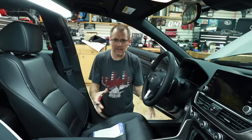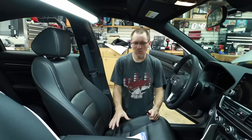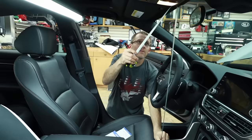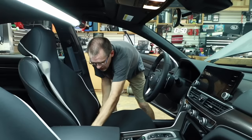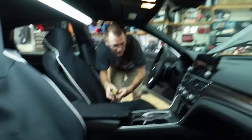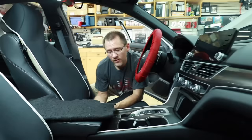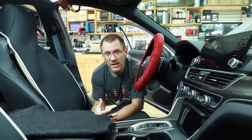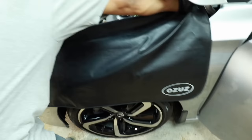We also gauge how big the customer is when sitting in the car, because we still need to tune the car. He's a tall gentleman, so we'll have to shim ourselves up in the seat so we're at about his head height when listening. Anytime we bring a car into the install bay we want to protect as much of the interior as possible — carpet over the armrest, a gear shifter boot, and the steering wheel gets covered. Any panel that's going to be removed or could possibly get scraped gets covered in tape, a couple different layers. Because we'll be working on the battery under the hood, we also protect the side of the vehicle and any other area we're working on.